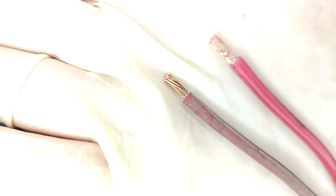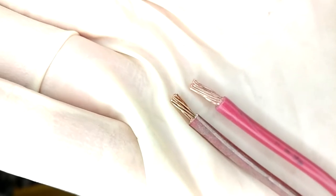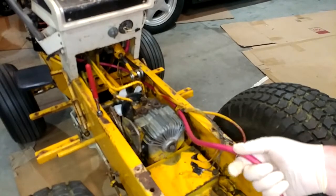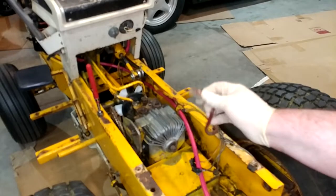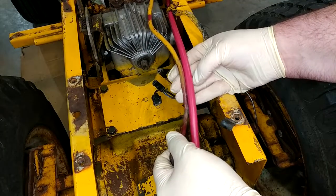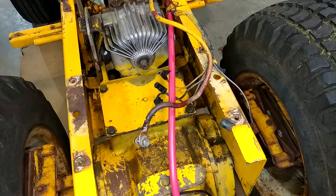I was going to take this original wire and strip it back and just crimp a ring terminal onto it, but you can see that wire is actually pretty corroded — pretty green in real life. I trimmed that nub off and tried again and found pretty much the same thing. Trimmed another inch and a half off and tried again and it's still tarnished over and looks crappy. This was good quality copper wire 50 years ago when the tractor was built, but time just ravages this stuff. I've got a piece of brand new 10 gauge right next to it to replace this wire, which I think is probably more like 12 gauge — you can see the difference pretty starkly. I'll just put my own ring terminal on it. So now I'm going to keep feeding the 2 gauge up and I'll probably have to pick the hydraulic cylinder up for a little more access, while also pulling the original cable out — and it is so stiff I'm having to cut it up to get it out.